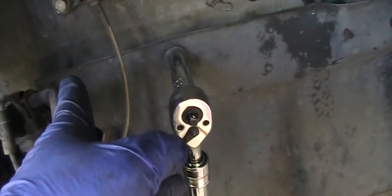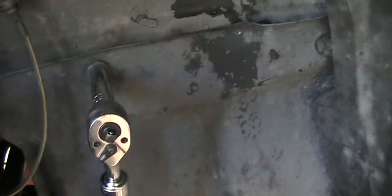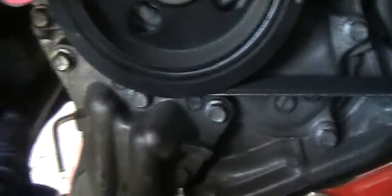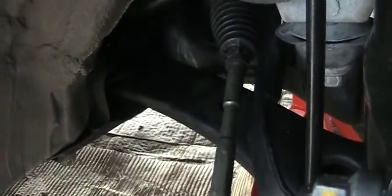There's some rubber clip and a 10mm bolt. Let me remove it and see how the oil filter housing looks. Okay, this is how it looks. That's the oil filter housing. So it is blocking the bolt, and you have 4 nuts: 1, 2, 3, and 4. So after removing it, then it will be any regular control arm change. So 1, 2, and 3 under the ball joint.